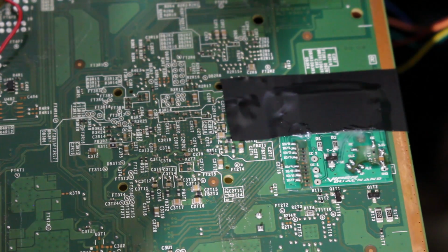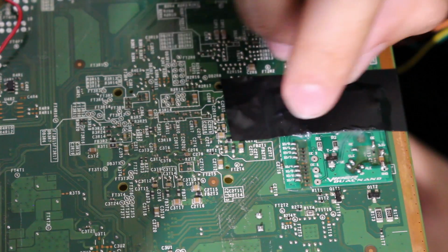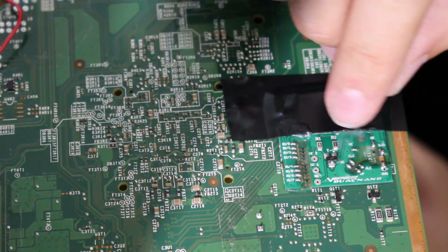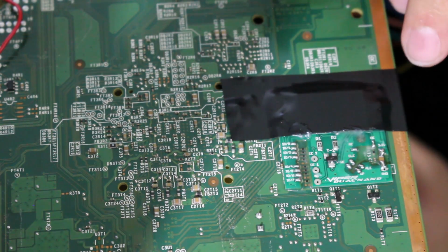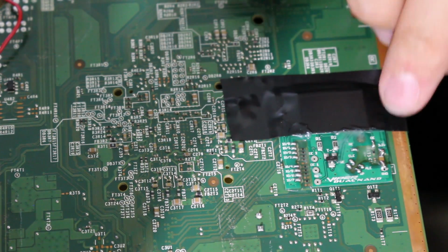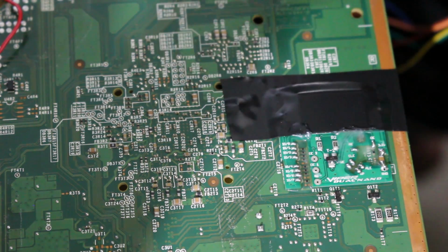And then what I do is when I'm leaning the soldering iron ever so gently like that, I bring in the solder, like I showed you right there, dab it in, and what it does is it ends up connecting the point on the top PCB to the bottom point, which is on the Xbox 360. And the result should be a nice, clean, circular type blob right there on each of these points. So we ended up doing 8, 6 points, 2 more points right there. So 16 points for this chip alone, but the PCB is now actually installed.